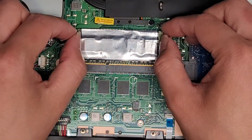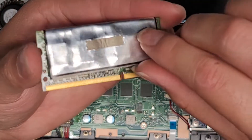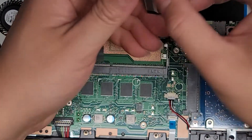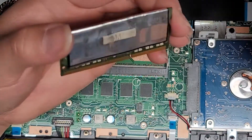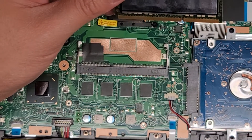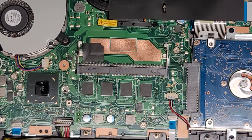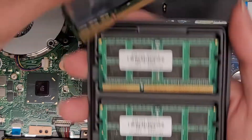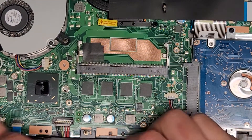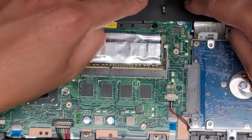There's only one stick of RAM — the other is soldered to the motherboard. Just pull these two tabs to the side to lift it out and it pops up. The problem is there's no label on this RAM, but it looks like DDR3. Let me compare it with a known DDR3 stick — yes, this is DDR3, you got PC3. I don't know the exact speed, but usually you can use any DDR3, though sometimes there might be speed conflicts to keep in mind.